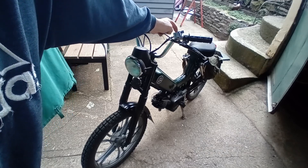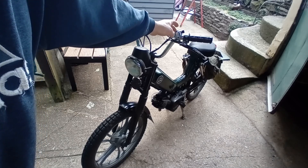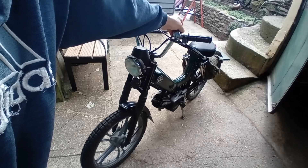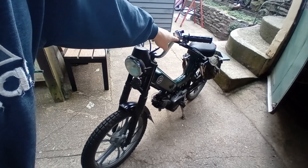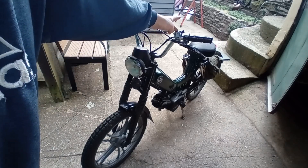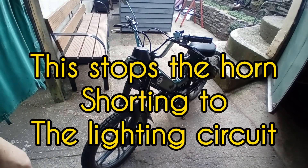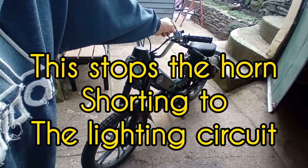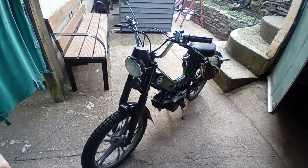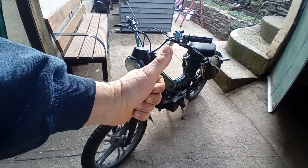Also, another thing with these aftermarket switches: there's no insulation on the underside of the horn switch. When the lights are off and you activate the horn, it works fine. But when the lights are on and you press it, it actually makes contact with the brass pivot for the headlight switch. On the underside of that brass pivot is the terminal for the pilot light, so when you press the horn with the lights on, the lights dim and the horn doesn't work. So we're going to put a piece of insulation tape underneath that contact to separate the two, and it will work fine. Thanks for watching, thanks for subscribing — take care, I'll see you again soon.